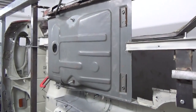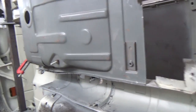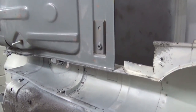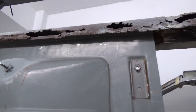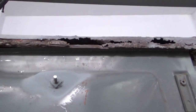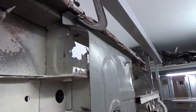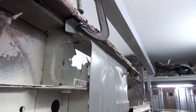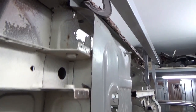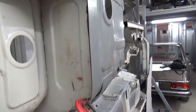Moving the old floor pan out and trying to fit in the new one, we needed to bend the edges a little bit to fit the width, but overall it's quite a close fit. Here we're clamping to the old rusty heater channel just for dimensions, just to see the width of the pan. The next part is to fill in this square recess section. The gap is quite close and we'll be repairing the other panel too.